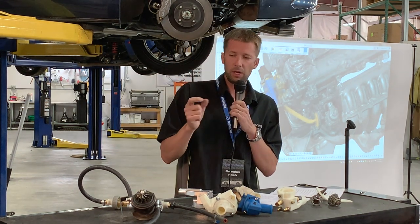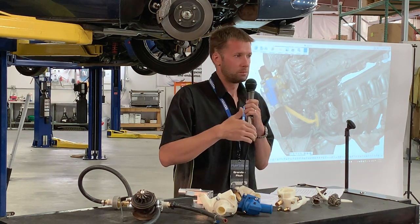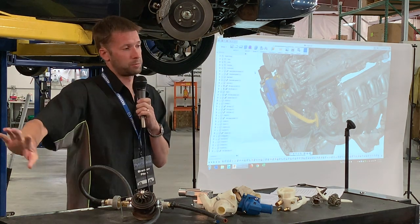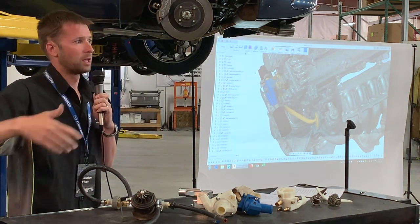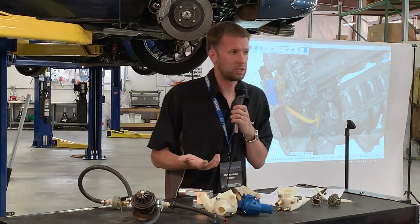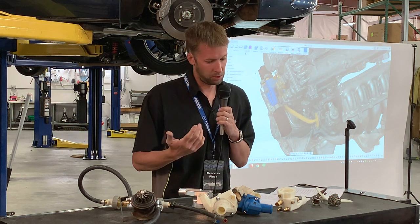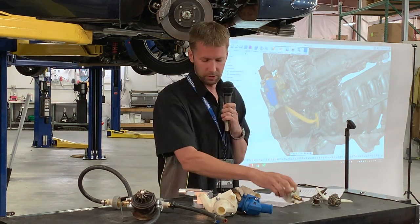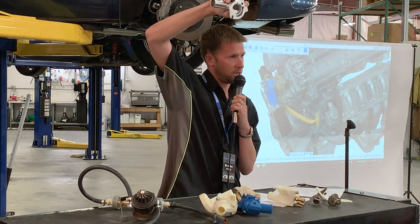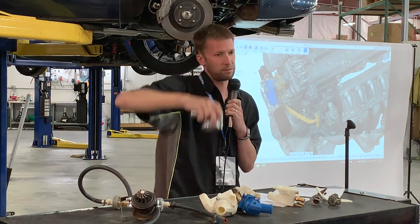Once we had narrowed it down to the general design that we wanted, we knew we had clearance on this specific setup, then we had to test everything else. Does it work on a 1.6? Well, 1.6 doesn't have EGR, but the coils are on the opposite side. So is it going to clear that? Almost. That's what this little cutout over here is for. You need that on a 1.6. Just detail stuff like that.